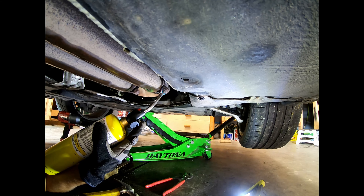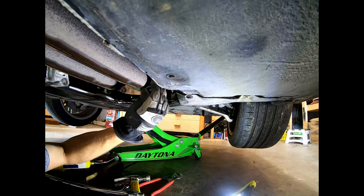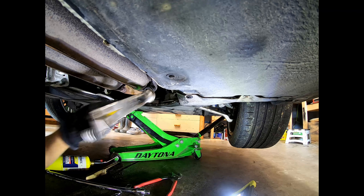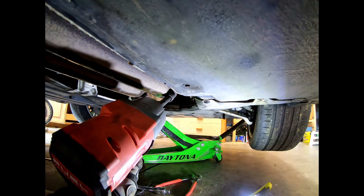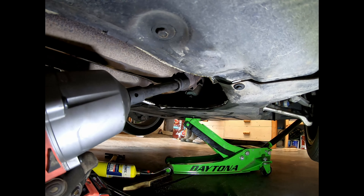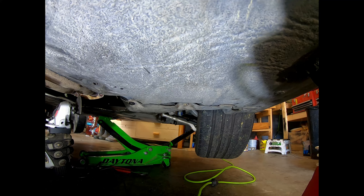The first thing was to remove the exhaust. At this joint right here — the flange — you can see just how rusted these nuts were. This is a 2006 330i, so as of 2020 these nuts look like they haven't been taken off in about 14 years, and it's quite evident. First thing I did was try to figure out the socket size. Some research online said 15 millimeter, so I tried that, but there was a little wiggle room — and that was a mistake. I got my 15 millimeter socket and rounded out that nut pretty good, then moved to the 14 millimeter, but it was so rounded out that I basically stripped that nut.